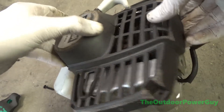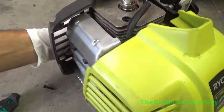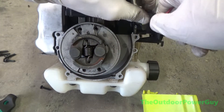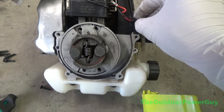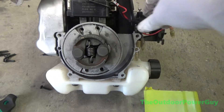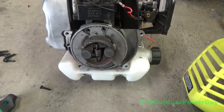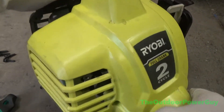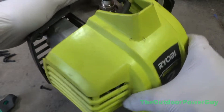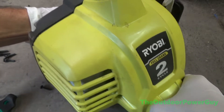Tighten this up and now we're going to put the clutch cover back on. This is real time, unedited — extremely easy. Make sure the little piece of heat shrink is in that groove, or your clutch cover will not line up. Tuck the wires back behind the air breather, then put the clutch cover back on. It's kind of tricky at first, but it will just pop into place.